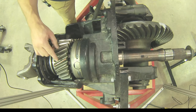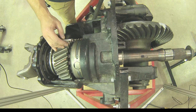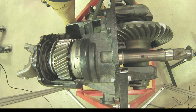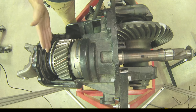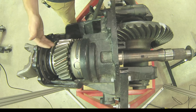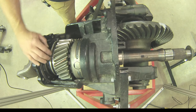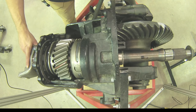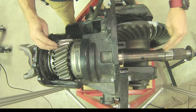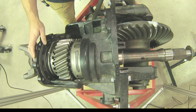In locked condition, my front and rear axles must drive at the same speed, but they're going to have possibly varying torques. The reason they might have varying torque is that with this lock we're not creating traction between the tire and the ground — all we're making sure is that they rotate at the same speed. The torque in the drive shaft will be determined by the path of greatest resistance. Whereas when we're unlocked, our speed can vary between front and back but our torque will be perfectly split between front and back. Those are the two modes of our interaxle differential.